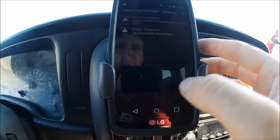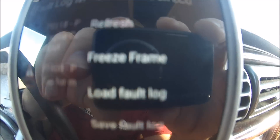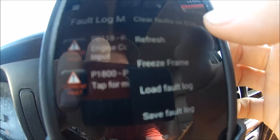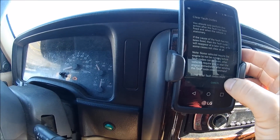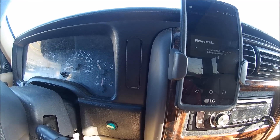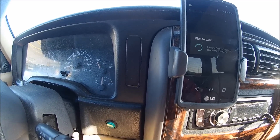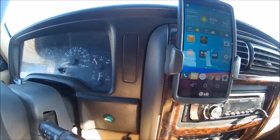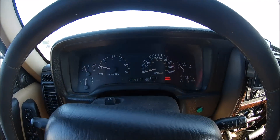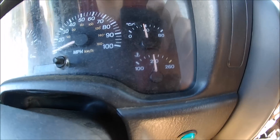To clear the code, I'm going to come up here and it gives you a list. At the top it says clear fault codes on ECU, and we can watch as the check engine light goes off. Click OK — and the check engine light went off. So now we just cleared the code and we'll start the Jeep back up. As you can see, our coolant temperature is reading as normal and now we don't have any codes.